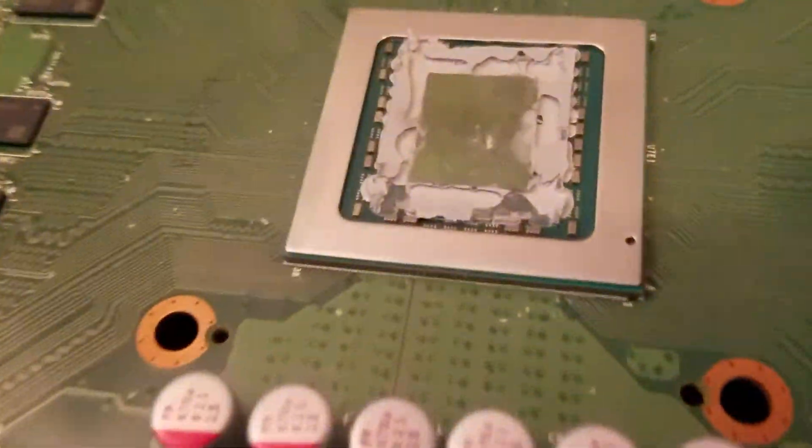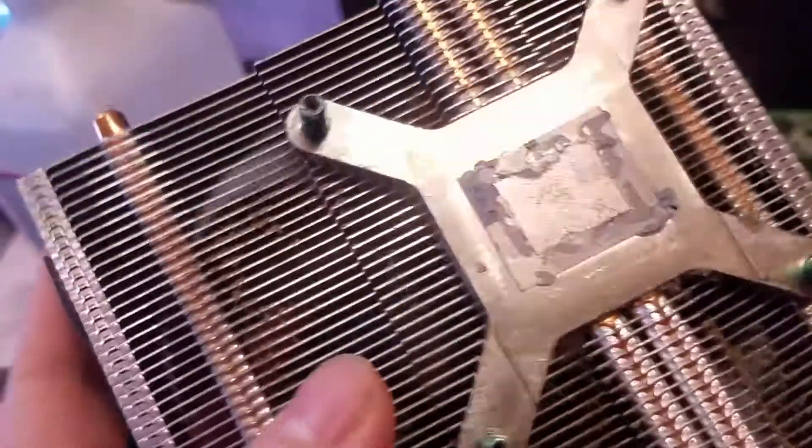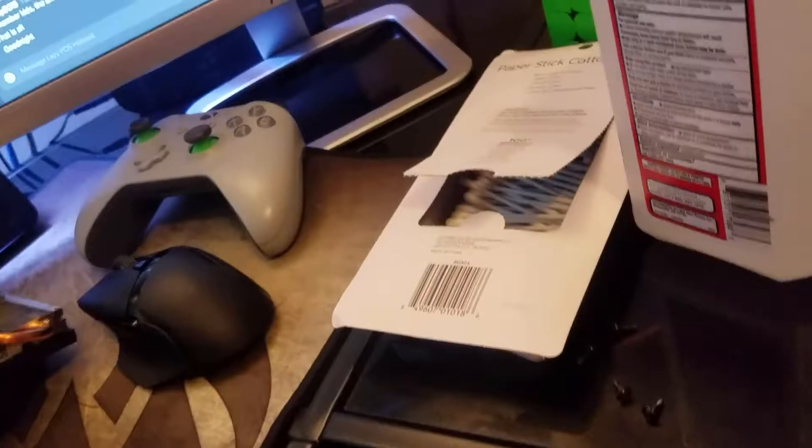Here's the hard drive right here. Pretty nasty. But here's another thing you should really take into consideration when you're buying products like this. I'm taking the heat sink off and everything, and look how dry this thermal paste is. I'm sitting here with the alcohol and everything, and this stuff is like — it's so dry, it's like stone almost.